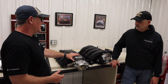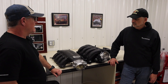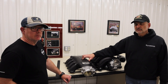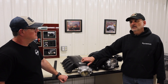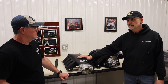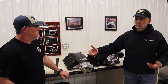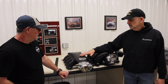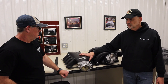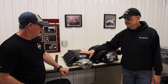My question to Brian is: what's the potential for naturally aspirated with this intake? We're really anxious to get it on with one of our Stage 2 heads and our 175-004 cam — about a 264-degree duration intake cam at 0.050 lift — with something around 11:1 compression ratio or higher. I would not be surprised if on our dyno we saw north of 700 horsepower. That's strong — and with a hydraulic roller, too.